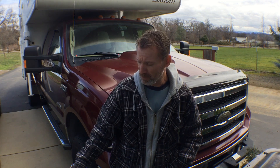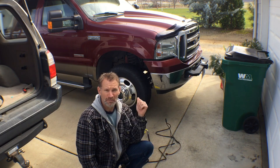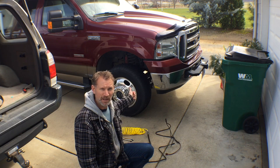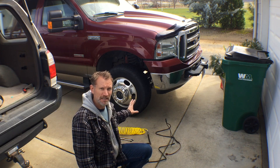They do recommend that you have your vehicle running while using the air compressor, so your alternator can generate what the batteries are using. This is a 45-amp draw maximum, so if you're ever creating that much draw and running it a lot, you want to have your vehicle motor running so you're charging your batteries during use. I'll go ahead and start the truck and get an air reading on this front tire — I think it's at about 65 PSI. I want to time how long it takes to get back up to 80 PSI.